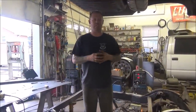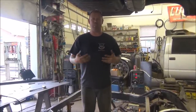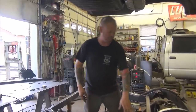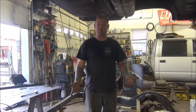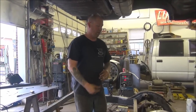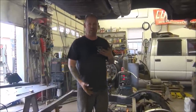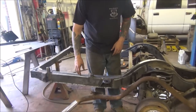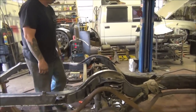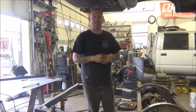A common question people with hydraulics have is: do I need to reinforce my frame? The answer is yes. How much depends on your setup. If you've got a G-body — Monte Carlo, Buick Regal, Cutlass Supreme — and just want to reinforce the arches, that's fine. But take into consideration how many batteries you're going to have. A battery typically weighs about 65 pounds. Six batteries at 65 pounds is about 400 pounds just in batteries in your trunk. With a convertible, we've taken many steps beyond that to actually box in the frame and remove the body so we can get to parts you really can't otherwise reach. If you're unable to do that, just attack the places you can get to. The arches are important, especially doing three-wheel — everybody loves three-wheel. If you're like me, taking a lift around every corner, you're going to bust the three-wheel.